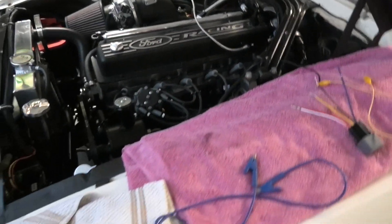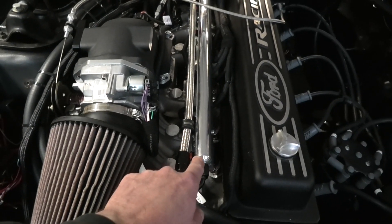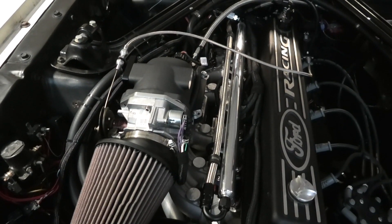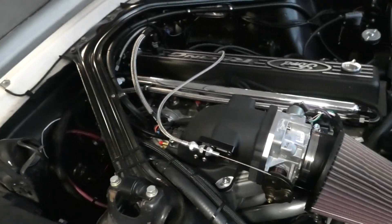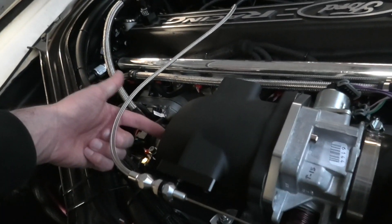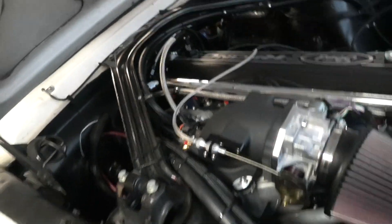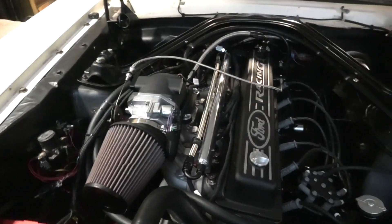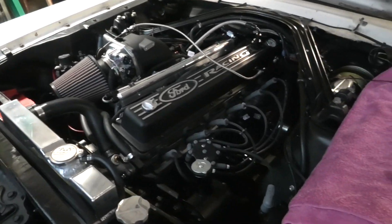Other than that, I've made some other modifications. I had fittings welded on here — I didn't like the way the O-rings were seated — and I cleaned up some things. I moved the manifold air temperature sensor to a better location, though it's still not great. I'm considering drilling and tapping a hole to get the sensor into the actual manifold, because it's kind of recessed and was heat soaking. It's still heat soaking to some extent, so I have the air temperature enrichment set at 100% all the time, meaning that sensor isn't really doing anything. The knock sensor is hooked up but not programmed yet.